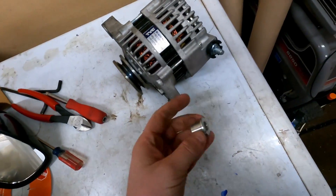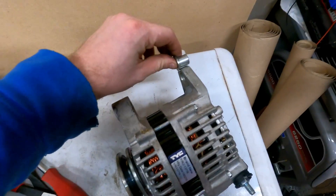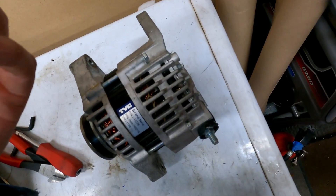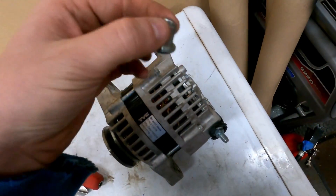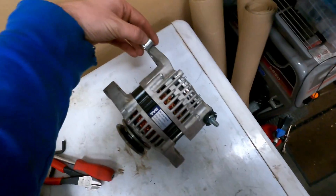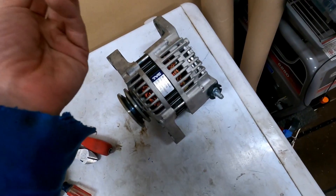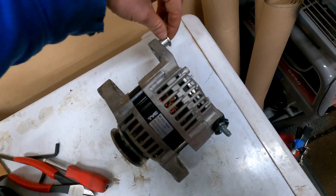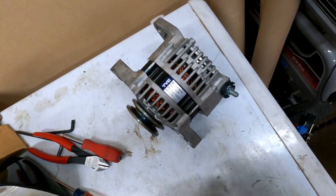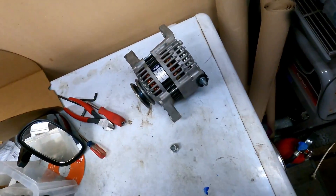I just had to make one modification: it came with a spacer on it. On the other one it was placed differently, so I had to pound it out. I used the spacer from the other alternator because it was like a cylinder without the lip. With the lip it was a little too narrow to fit over the alternator bracket. I think if I had just reversed the sides putting it in, everything would have been fine and it still would have held great.